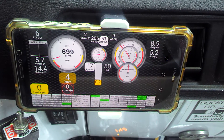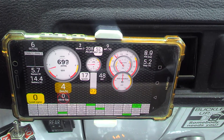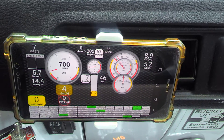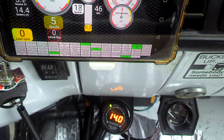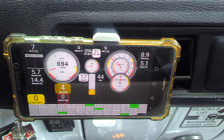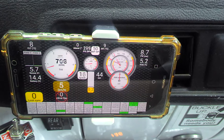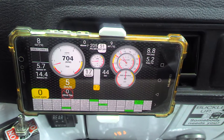Pretty cool dashboard, isn't it? Shows to the right the AFR gauge — the target AFR and the true AFR it's reading. That's the real AFR gauge. It shows EGO correction, which doesn't come on until coolant is 50 degrees — I believe 50 or 40. And it shows coolant temperature, RPM, and speed.